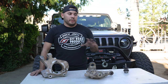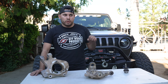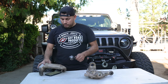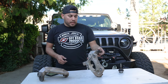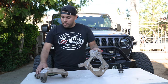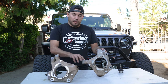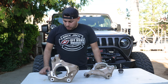It drives completely different. It used to be that every single pothole, every time I went over railroad tracks, I would either get bump steer — a huge amount of play out of nowhere through the steering wheel — or I'd get good old death wobble that the steering stabilizer kind of took care of, but it was never addressing the problem. The ball joints were really loose — at least two of them were — which translated to really loose steering. The aluminum knuckles, as we talked about earlier, are lightweight but not very durable. The spots where the Steersmart metal washers were rubbing against them were eating away at the aluminum, which was causing even more play — pretty well divoted out from riding on 37-inch tires.